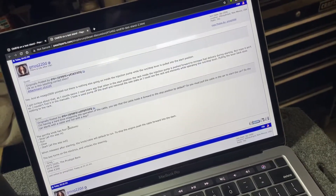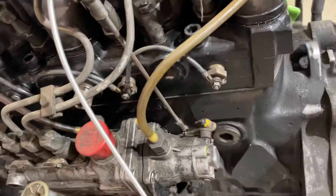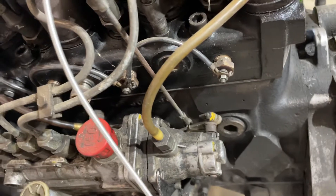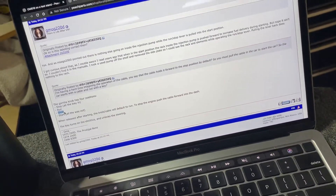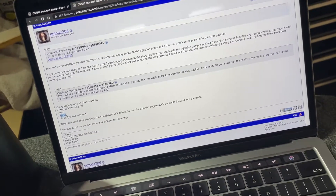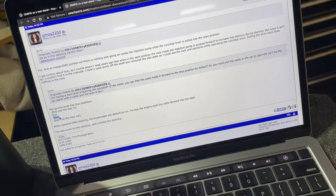The gorilla knob has four positions: stop, run, glow, start — glow plugs too. I think these are the updated glow plugs, the series glow plugs, and all I have to do is put 12 volts on here and it's glowing, I'm pretty sure. I don't know if the glow plugs are on a timer — like they glow for 10 seconds and automatically shut off — or if they actually sense how hot they're getting. So it's just a timer; I could easily set up a timer or just time it manually.